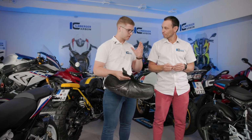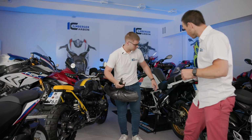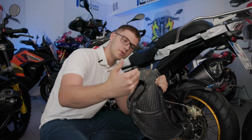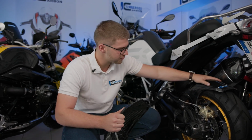Thank you, Daniel. Yeah, as you already mentioned, it is a completely patented screwing. So this means we really thought about how we can do this the best. Because you know, it's a one-armed swing arm, so it's always difficult if it's only in one surface, in one layer, then it's always difficult with stability. Now you can see we made two different levels on how it's screwed. This means we have one screw on the outside where the brake caliper is, and we have two screws on the inside of the cardan. This allows us that this fender is really tight on the motorcycle, tighter than anything else, I would say.